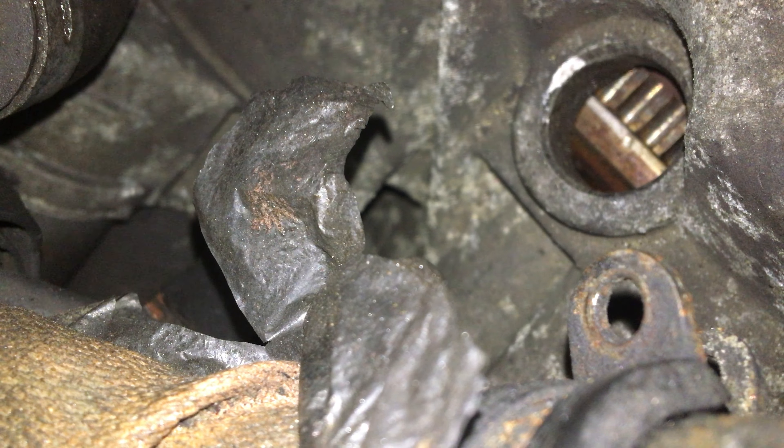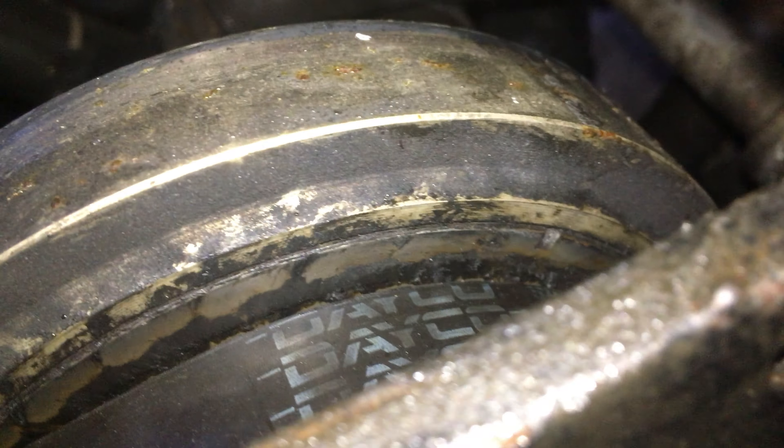There's also a mark on the pump. On the inside of the pulley on the pump you can see that little notch just above the actual belt itself to the right. That notch indicates the timing, and if you look across on the other side of the bracket on the actual housing of the pump, there will also be a ridge — a raised bit of cast metal. With the diesel pump, it may not line up exactly because fine timing is done within the fuel pump itself.